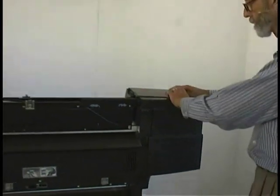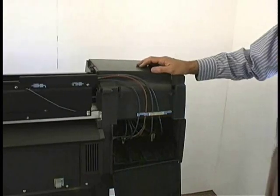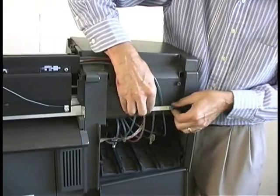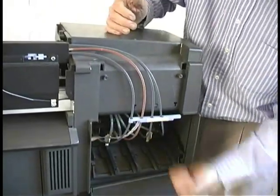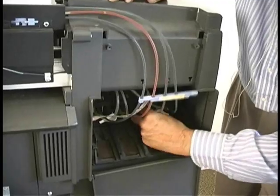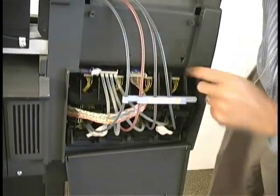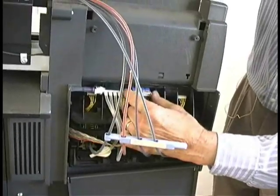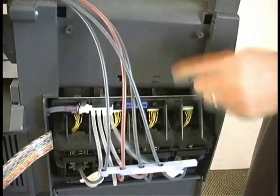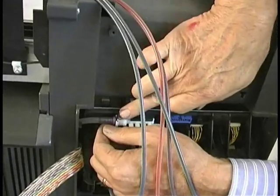On the left side here is where the back of the ink station is. First thing you need to do is unlock this latch - sometimes it's stiff and you might have to tap it with a screwdriver from underneath. There are two latches here - we're going to undo those and bring this out to where we can take off this multicolored ribbon cable. You squeeze on the sides of it and it just comes off. There's also a connection to the air pressure system - you push down on the silver button and it comes loose. Now this just comes right out.